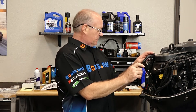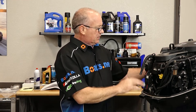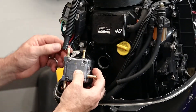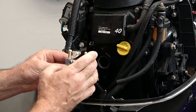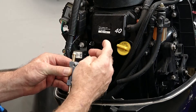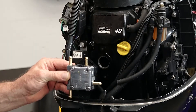Let me grab the pump and we'll get it remounted. It's actually missing a hose that goes to the VST tank and I have a length of hose for that. We'll get it remounted, go ahead and pull the VST tank, take it over to the teardown bench, pull it apart, and then we'll see what we have to work with. Our lines are as follows: this is actually a water line that passes through for fuel cooling, this is your input from the filter, and then this upper one — the smaller of the two — heads over to the VST tank.